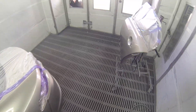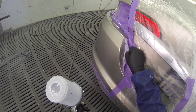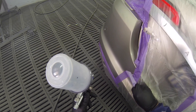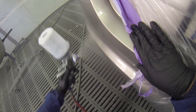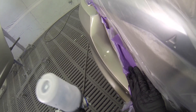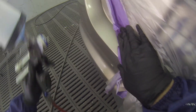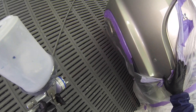This is also where it's good to wear gloves. If you're coming along doing things like this you'll obviously get clear overspray on the surrounding tape which makes your fingers all sticky. You should technically wear gloves anyway, but each to their own. Doing that clear blend on the bumper bar now — just melting it in nicely, putting light coats, not putting a lot on at all.